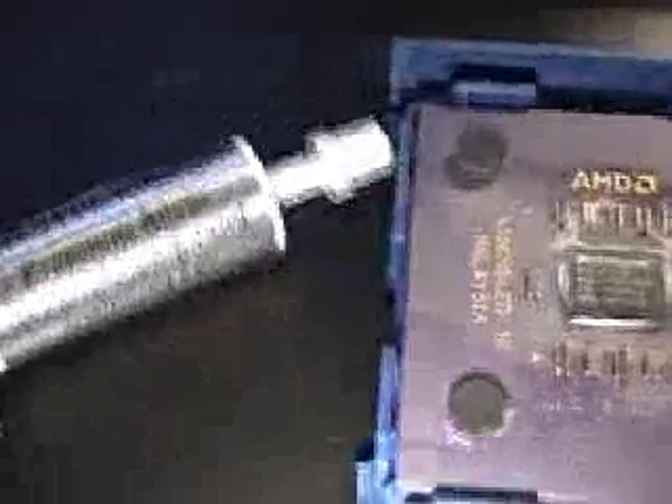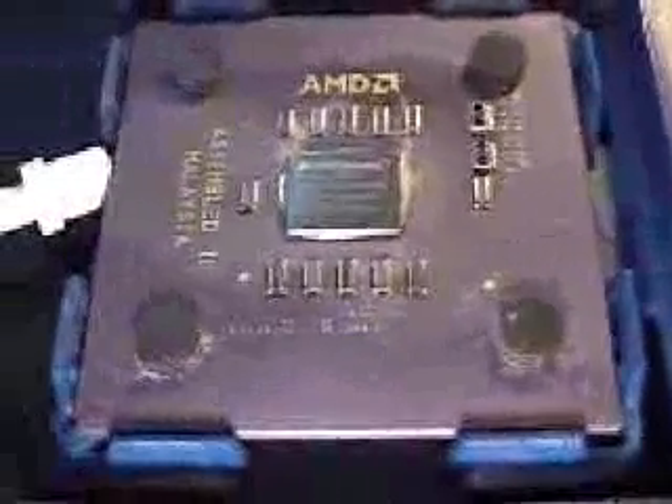The old-fashioned thick razor blades are probably the best thing to use, for the simple fact that they have a big footprint but they're very thin, and you can spread it with reasonable accuracy across the surface of your CPU. You can also use a thin ruler, a credit card, or any type of thin plastic. I would not recommend any type of metal because you could damage the CPU. Anything thin and plastic would suffice.